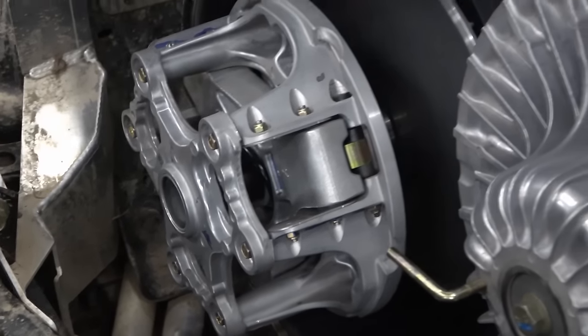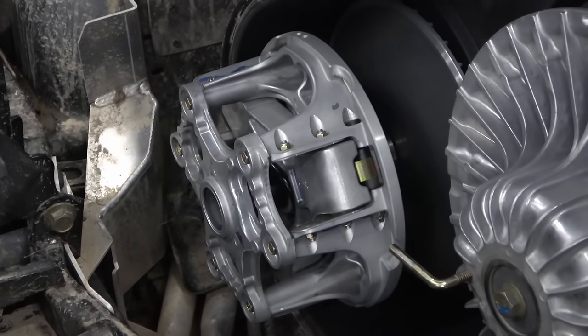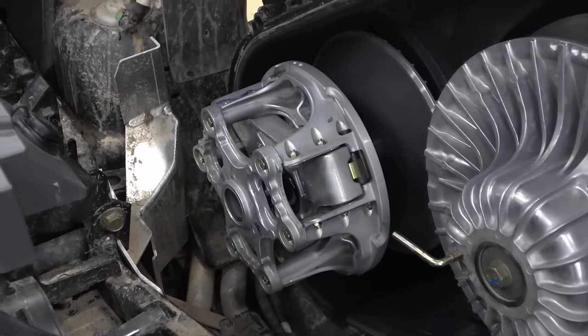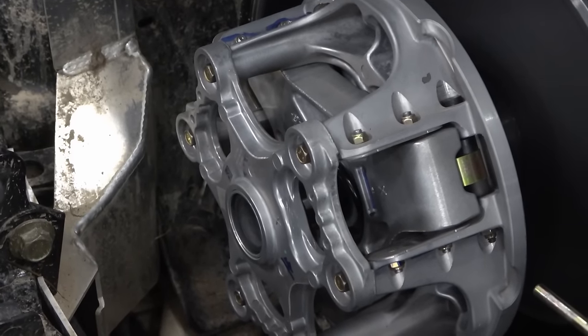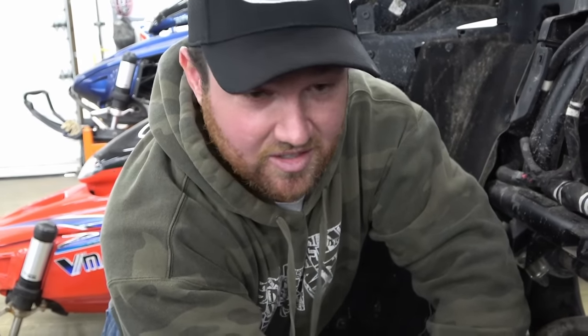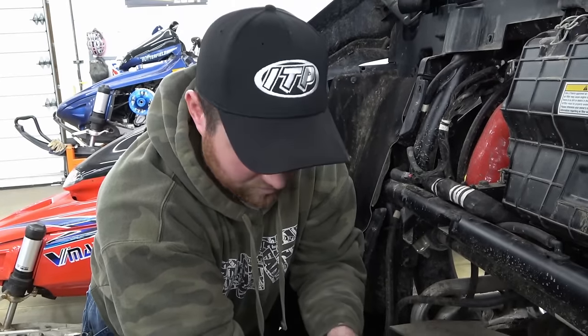If you were to go ahead and upgrade your clutch weights, I highly recommend it. Go to Evolution Powersports or sidebysideblogparts.com and get yourself a clutch kit for one of these — it does make a big difference. The next step would be to remove this cover off of the primary clutch, which has six 10mm bolts. The spring behind the primary on these Pro-Rs is not super heavy duty — you can put your hand on it and take it off no problem. Some machines have heavy springs where you need a tool to hold the spring, but these have real light springs.